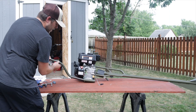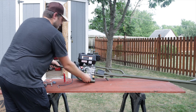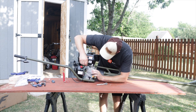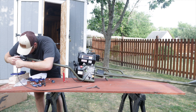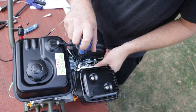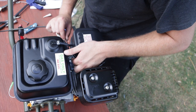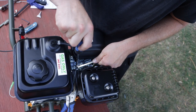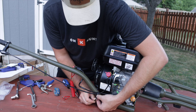Now we attach the handle, which slides right into place. You take your T-pin, throw it in there and it's ready to rock. Next we set up the kill switch, which is pretty easy — it's all pretty straightforward the way they've got it wired up, you just plug it in. Then I run the throttle cable in, getting it nice and tight in the right place. In the throttle body you want it nice and tight with not a lot of slop. It took me a bit of trying, but the instructions are super straightforward. I used some vice grips to hold the cord while getting it tightened down — it's a snappy little setup.